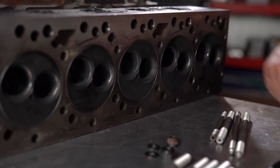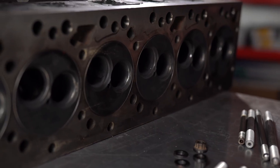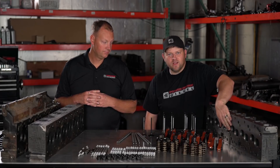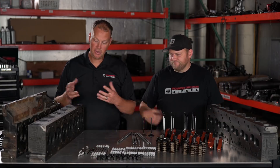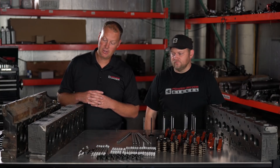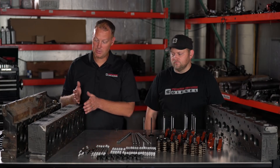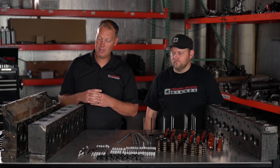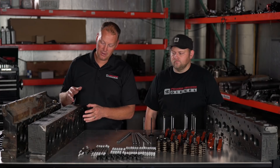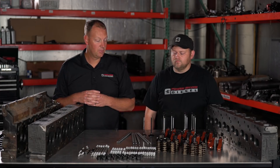You're also going to want to have a fire ring cut into this head. You're not going to make this kind of power on a stock head gasket. This is how they come — smooth, no fire rings, ready to drop on. When you call us and order one of these heads, we can fire-ring it for you. Just let us know if you want the fire ring in the head or split across the block — there are all kinds of ways to do it. But you've got to have some kind of fire ring. Personally, at this level, I think it should be fire-ringed, and it can work out really well for you.